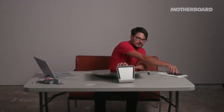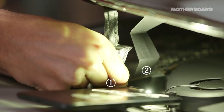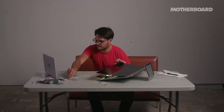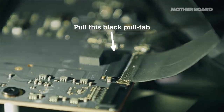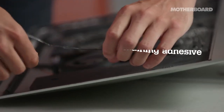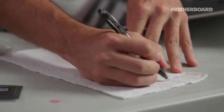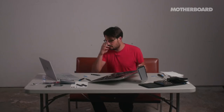I'm going to pull out my phone and light the inside. There are two wires in here that I want to disconnect that are connected to the logic board. This just comes out — you just pull it against the connector. One is disconnected. If you're following along at home and trying to do this yourself, this is around step 20. There's another cable in here where you need to flip something up before you pull it out. I was a little scared to be rough with it — I just wasn't pulling hard enough. I'm going to take these five screws out.